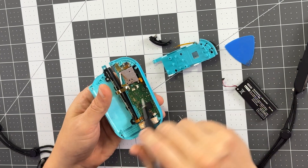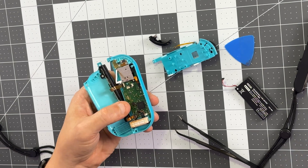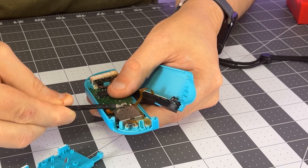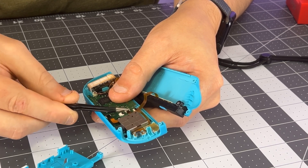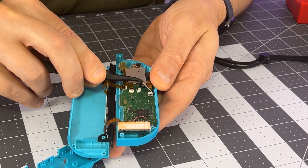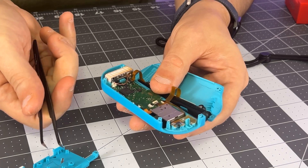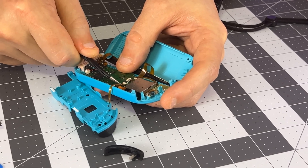Turn over and make sure all the buttons are still situated and clicky. Hold onto the back of the circuit board with your thumbs and give them a quick test. If they're still good, flip back over. Otherwise, you've got the trouble of going in and setting everything in place. The good news is the buttons only fit one way. If your shoulder button pops off, no big deal—that's easy to fix. We're going to reattach this ribbon cable—just push until you feel a little resistance; it doesn't go in as far as you think it does. Then we'll reattach the joystick ribbon cable, look for the hole it slides into, push in only until you feel it lock, and give it the slightest tug to confirm it's fully locked. And then we'll attach the ribbon cable for the mid-frame—this is the most finicky one of all.